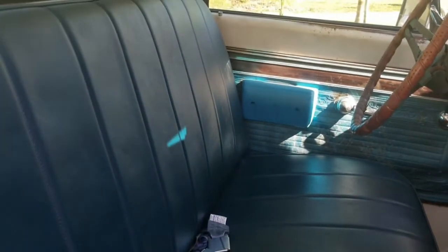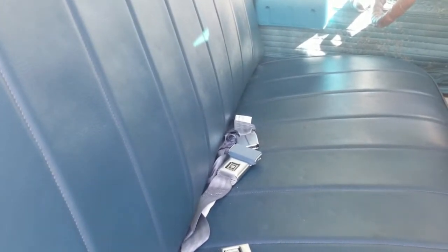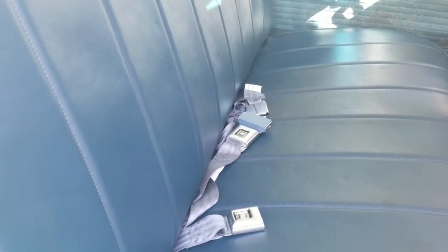There's the finished product — seatbelts are in, and shoulder belts. They look really good, work really good. The only thing we ran into is the center belts were originally held with a shouldered bolt that would not go through the plates on the bottom of these belts. So I just ran into a big box store and got some grade 8 hardware that didn't have the shoulder, with the right thread, and everything worked great.